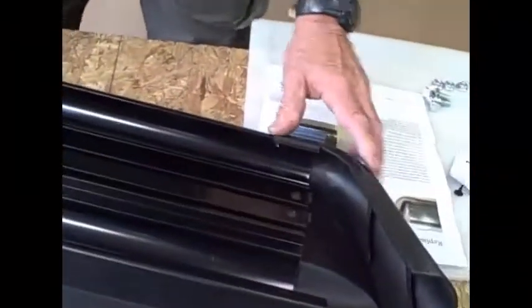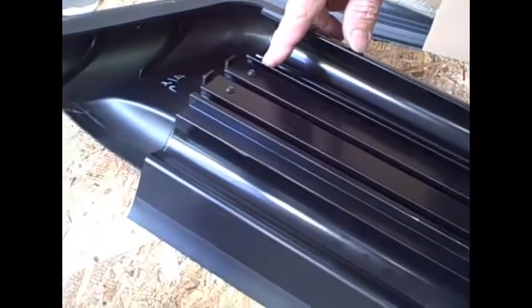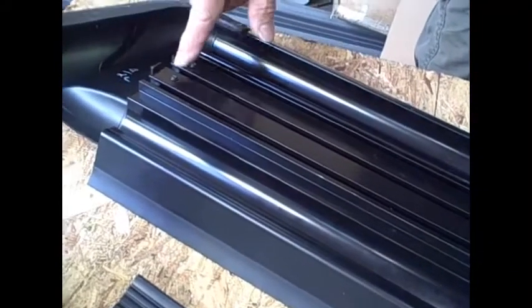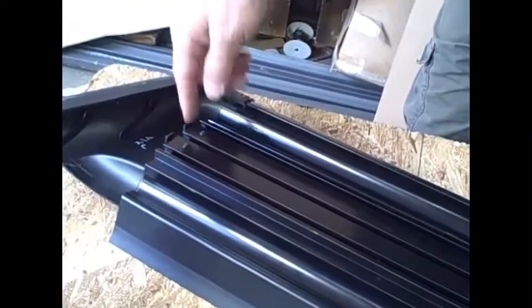If you look on the underside of the step, there are three screws holding each one of these end caps on. The two outer screws screw right into aluminum. Now there's something significant about these screws — you're going to notice that two of the screws have wider heads and two of them are smaller. You've got to get them all out, and sometimes these smaller head screws bind and you're not going to get them out. So you may have to drill the screw heads out, and you'll be able to put new screws next to where they are once you reinstall them. You're going to drill these out, take these screws out, and pop the end caps off.